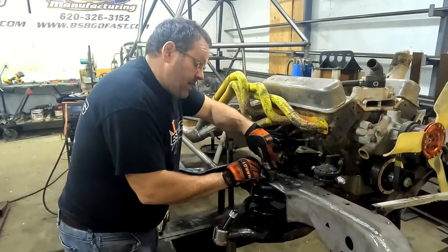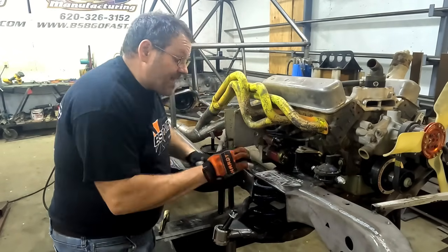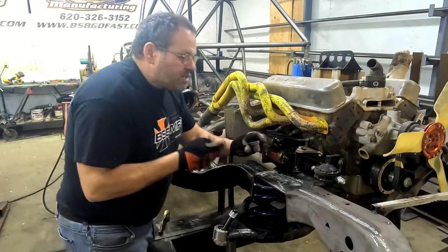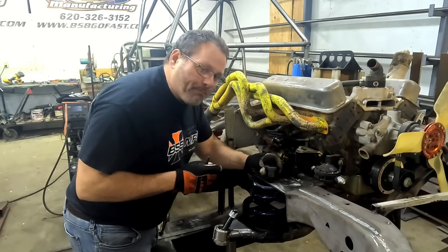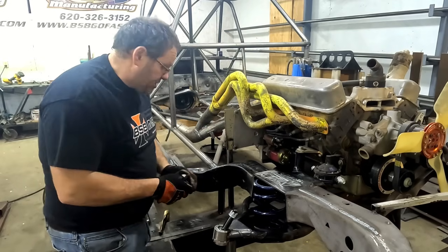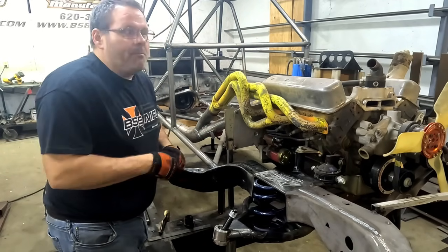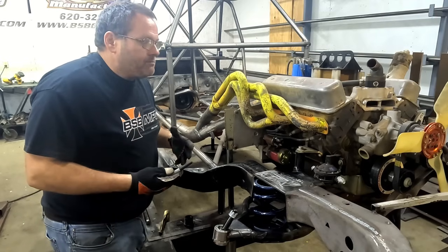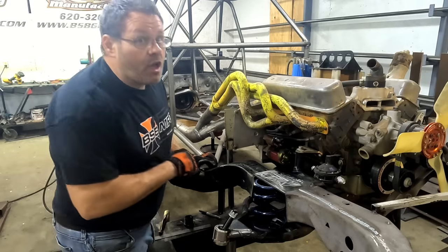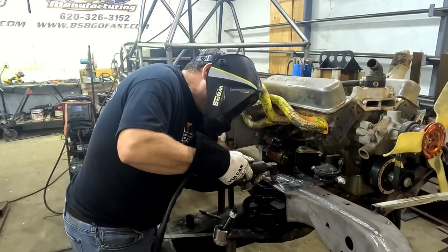I'm marking right in the middle of the X, making my mark all the way around — because that's on an angle and this spring is on an angle. Everything's on an angle. So it's not enough to just put the jack bolt here; we have to have the jack shaft correctly aligned to the spring. It's two things here, and I don't think I got either of them right enough on the crush. I was close, but not close enough. Plasma torch — let's get this cut out.